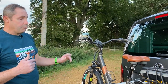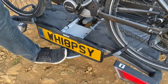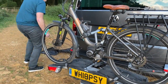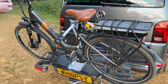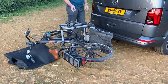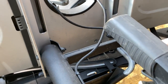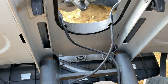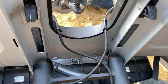In terms of opening the tailgate, that's quite interesting because this foot piece here — you press down and then the whole thing swivels, which is great. What we tend to do — just grab the cover for it, you'll see why. So when you bring this down, you can actually bring it all the way down and rest it on the floor like that. The only reason that this bike carrier goes that far is here at the end of these lines — they used to have plastic bungs in. When you have it delivered, there's a couple of plastic bungs in here which limits how far this can go over. All you need to do is undo those couple of bolts, take them out, take the bungs out, put those bolts back in, and you get the full movement right down. You just need to protect your handlebars when you lie it down, otherwise you might end up scratching things.